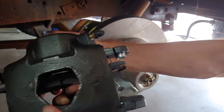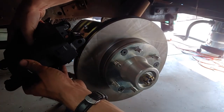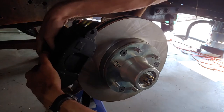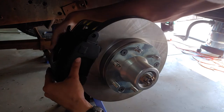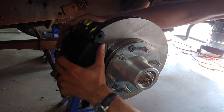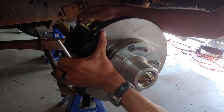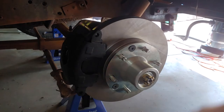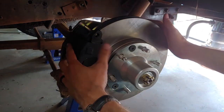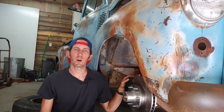Once the rotor and hub assembly is installed and tightened down, it's time to install the caliper and pads. Make sure the caliper has the bleeder screw facing up. It's a snug fit and a bit of a trick — start with the front and wiggle it back and forth until it drops into place. Then feed your two caliper screws from the back; the threads are on the caliper bracket, just through the two pads. Tighten it down, install your wheel, and make sure everything spins freely. Steer back and forth to confirm no clearance issues, then you're ready to bleed the brakes.